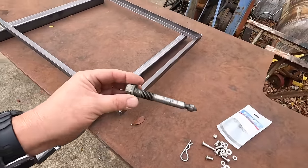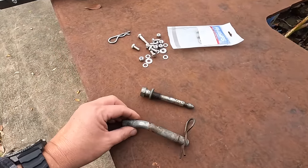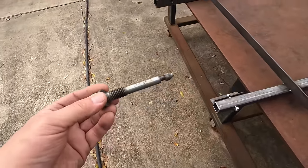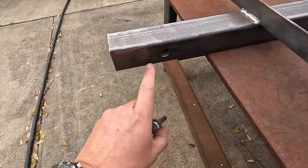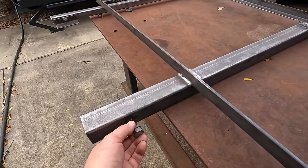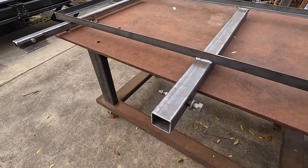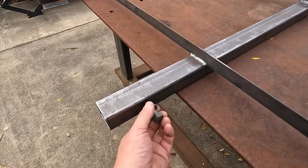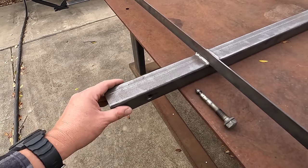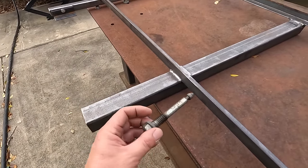I also wanted to point out this center pin — in place of a 5/8ths lock pin, this is more like a bolt with a slot for a cotter key on the outside for safety. It comes with a spring-loaded square nut so it doesn't spin inside the tube. When you put the pin through and tighten it up, the nut on the inside gets pulled to the inside of the tube which locks it in place. I really recommend this for any insert that goes into your receiver hitch — it keeps the thing from rocking around and shaking like you usually see.